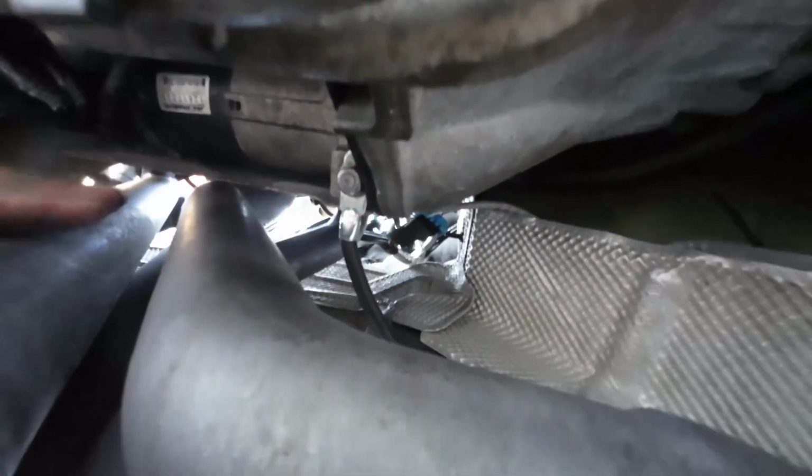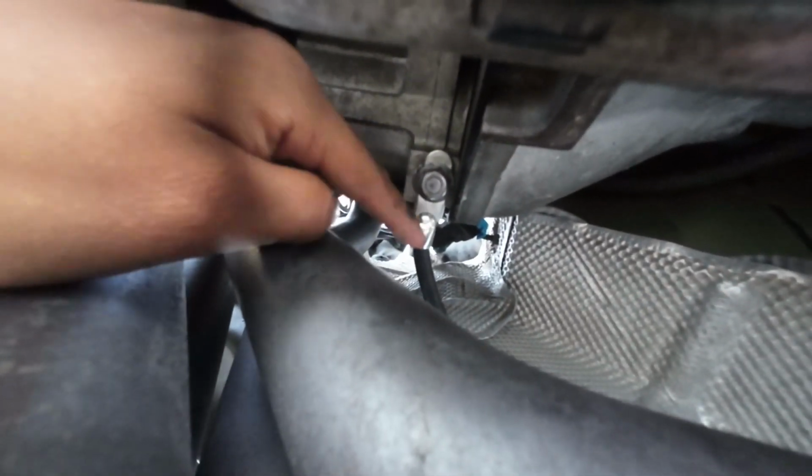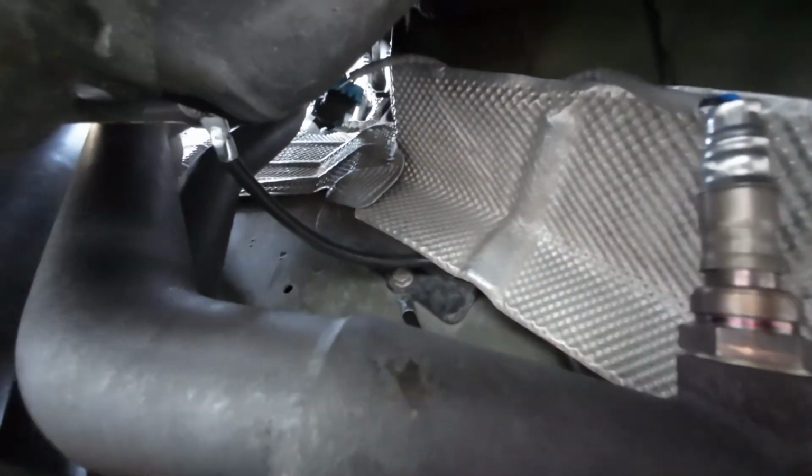So after a couple minutes of messing around, here's what I've got. So we've got our ground wire here where the starter bolt was. It is here, and then it runs back to the bolt that is up here, as you can see. Now on this bolt, there's this little heat grate thing right there. I tucked the wire under the grate, that way it's making direct contact with the chassis, and then put the bolt through. And I tried to tuck as much wire as I could under this factory heat shielding. That way it stays away from the header, and then moving up to here, there's a decent little gap between the wire and the header. So I'm happy with that. Let's get back up on top of the vehicle and let's see if it made a difference.